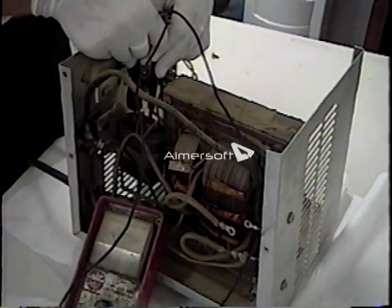The next thing we're going to test is the capacitor. The capacitor stores up and then releases the charge. We need to disconnect one side of it, and we touch our positive probe to one side and our negative clip to the other side. You'll notice the ohms meter will kind of jump momentarily. And then as we reverse the polarity of the probes, you'll see it jump again. And we reverse again and probe it, and it will jump again.